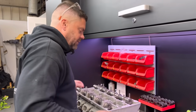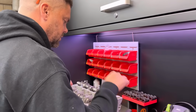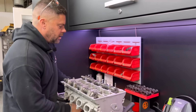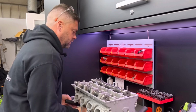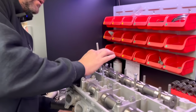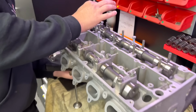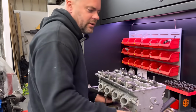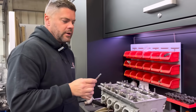Proper. So if we just place that camshaft in there, and then use a valve. Do excuse my cold. It's hard to think straight when you've got a cold, isn't it? It is. So if we put that valve in there now. Just get that magnet. Got a bit of clearance there, mate. That's good news. On my feel it is about 6 thou, which is ideal because I'm pretty sure that these clearances are 8 and 10 thou. Right, so you're nearly there.